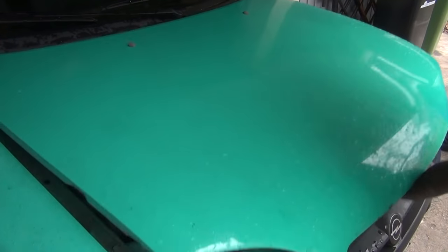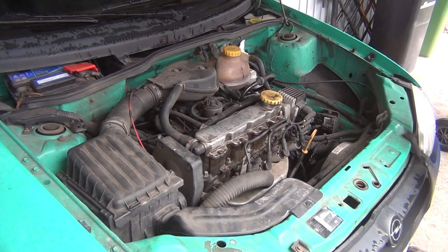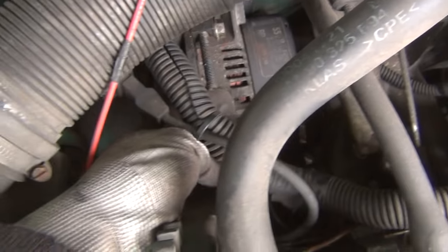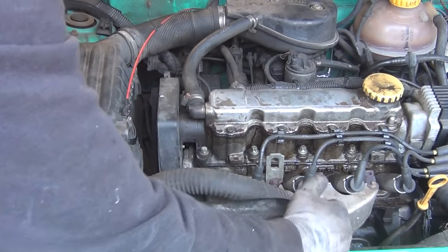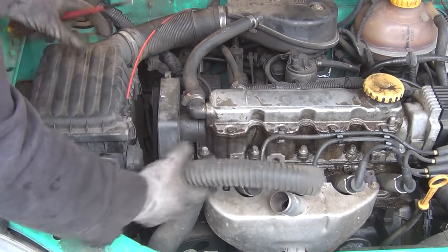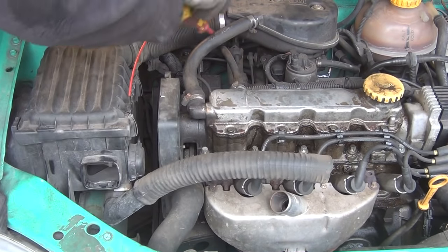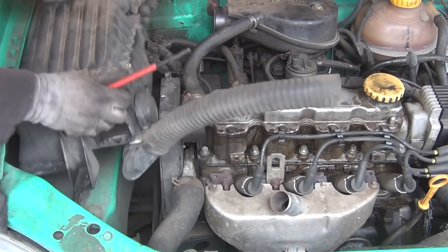While changing the tires, I got a glimpse of the alternator belt and saw that it was in very poor shape. Therefore, I already ordered a replacement part. The alternator sits down here and is not easy to work on like this. Hence, I will now remove some parts of the air filtering system. Now the alternator can be worked on easily.